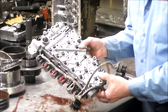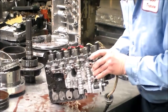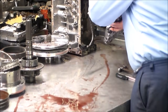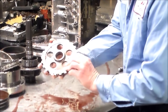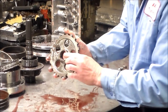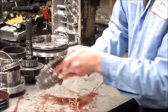Definitely going to open this up. The solenoids are all lined up here, versus on the F5A51 where you've got like three and three. Manual valve. Here is your park gear — hold onto the snap ring. This has a little more recess there. So I marked it — this is going to face out with the snap ring on here, and this larger part faces out.